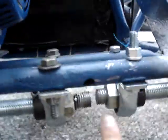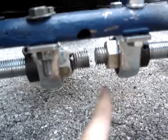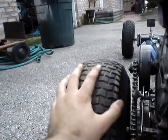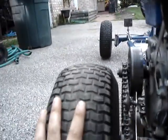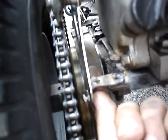What I had to do with the rear axle is kind of interesting — I had to cut it in half here and get two pillow brackets. I think that might have been my last update, but I don't remember because it's been months. That only makes the left-hand tire turn because with two, it was just understeering. Also, the other problem I was having was my chain was coming off. Today I actually made this little tensioner out of an old bike derailleur and just welded a piece of steel on here and bolted it on.